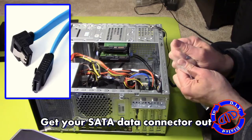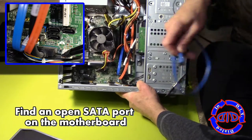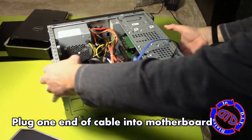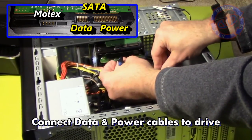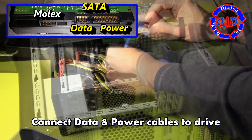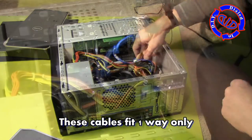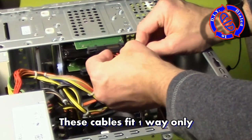The particular SATA cable that I got looks just like this. I'm going to show you the spot where it plugs into the computer, because on my motherboard I had several extra spots just to the right of that orange cable you see there. I just picked the first open one next to the previous ones that were already plugged in. The cool thing about a SATA cable is it goes in one way — you can't accidentally put it in backwards. In the inset picture you can see the shorter section for the SATA data connection, and the larger section is where I hook up the power. I put the blue data cable on first, then found the first available SATA power cable from my power supply and hooked that up to my new drive as well.